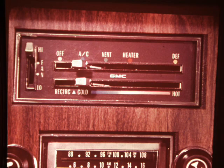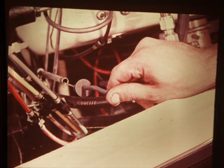The automotive air conditioner, if the vehicle has one, should be normalized once a month. Start the engine and set the controls for maximum cooling and high blower. Let it run for about 15 minutes. Also, check the engine oil level after running the engine. Allow time for the oil to run down to the sump when the engine stops. After the check, be sure to seat the dipstick properly to keep out moisture.